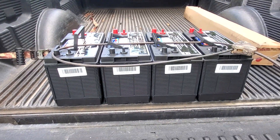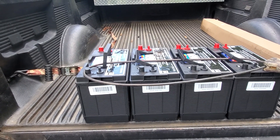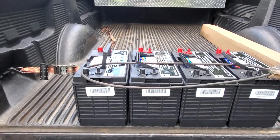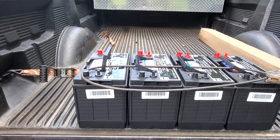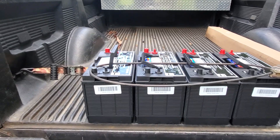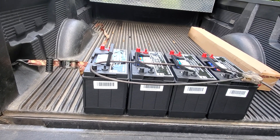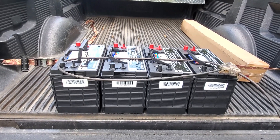They are guaranteed for two years, so if one doesn't take a charge or doesn't last long enough, I can just take it right back to Walmart and get a new one. And if you look back a few videos ago, I had my old batteries — the same brand that I bought in 2014 — that are still in use today. They have lasted six years. I don't let the batteries get below 12.3 volts, I make sure they're fully charged during the week before I use them, and every year or so I pop the caps off and make sure they're full of distilled water. That's it — they don't get abused.